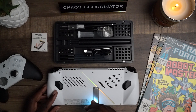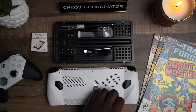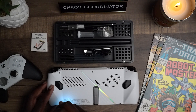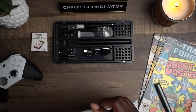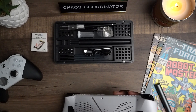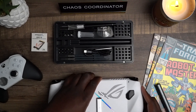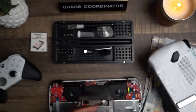We've got about two more screws left — might have to loosen these a little bit further. We do want to use a pry tool if we have one available, as it makes the job a lot easier when it comes to popping the back open. Unlike the Steam Deck, there are no ribbons in here that you have to worry about breaking during this process. I have pretty long nails so I can pop this out pretty easily. All these screws are the same length, so you don't have to worry about getting them mixed up. That screw is still in there and that's not something you have to take out.